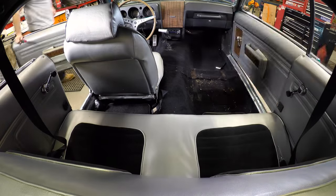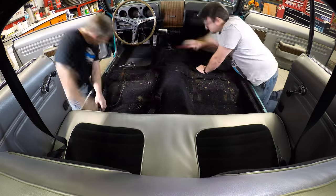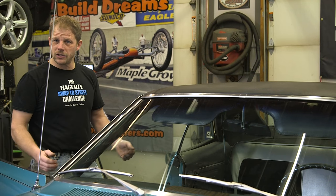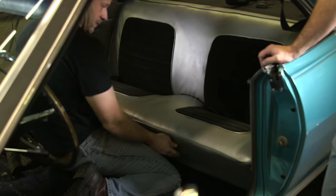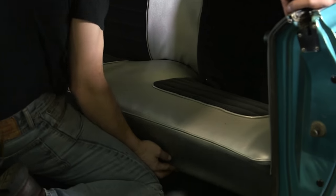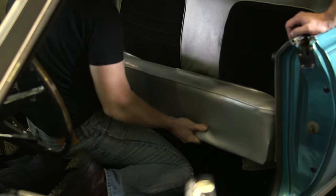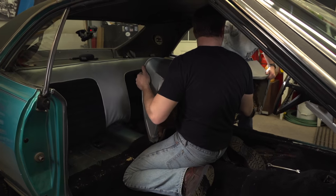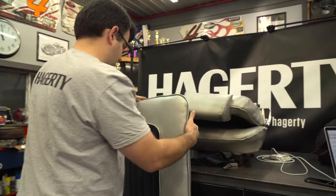We got the carpet ready with the exception of the back seat. The back seats are not tricky — all you have to take out is the lower cushion and they're actually just spring-loaded into a clip. At the very bottom of the seat you can hear them release — push it in, just slide it out. There are a couple of manufacturers that use a screw or a bolt, but that'll be obvious when you're looking at it.